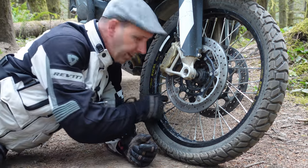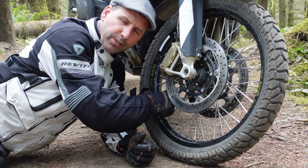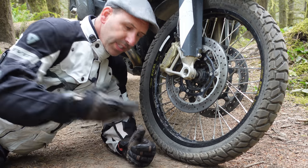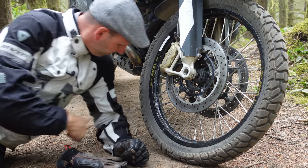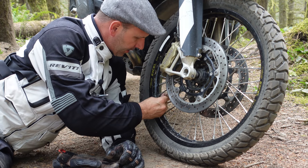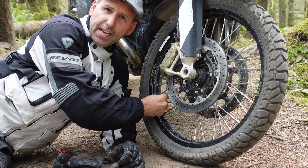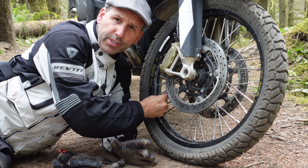Here's a fun piece of advice I've been hearing for years: when you go off-road, you always need to air down your tires. I was kind of wondering about this one. The idea behind it is that by airing down you get more traction and more tire to the ground.